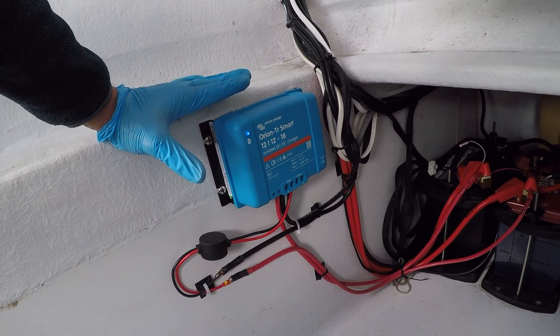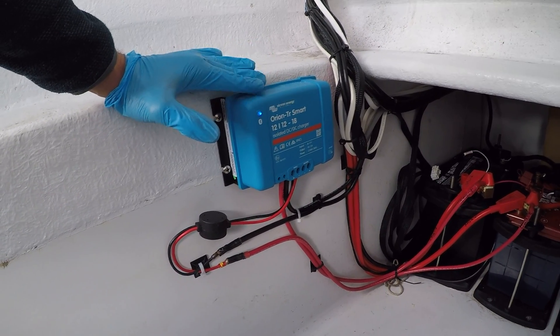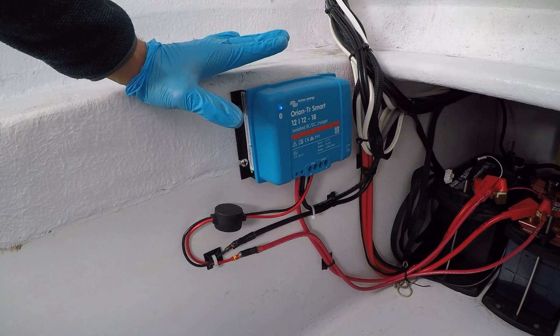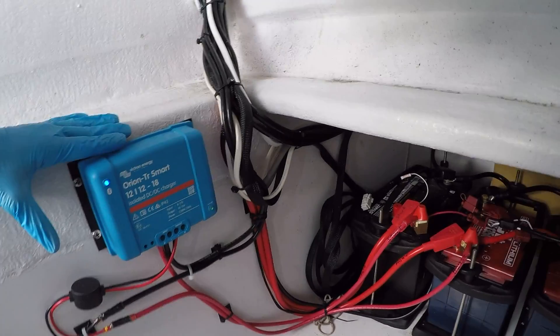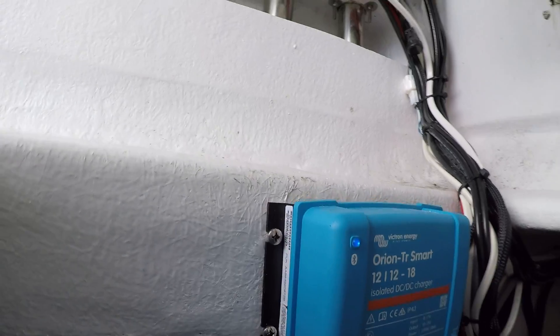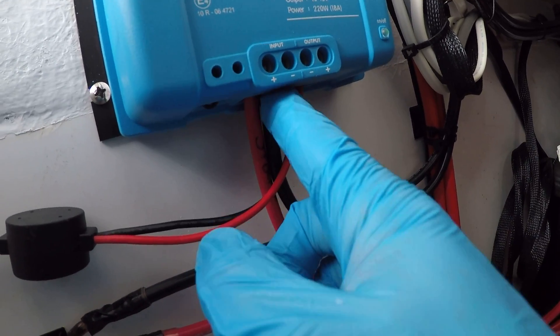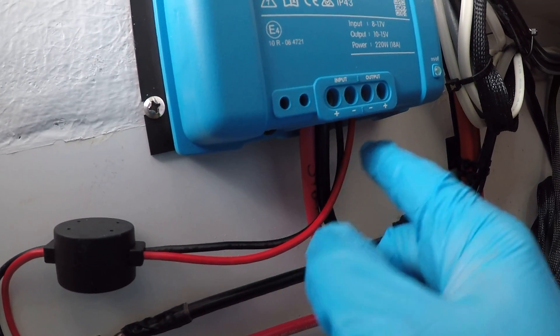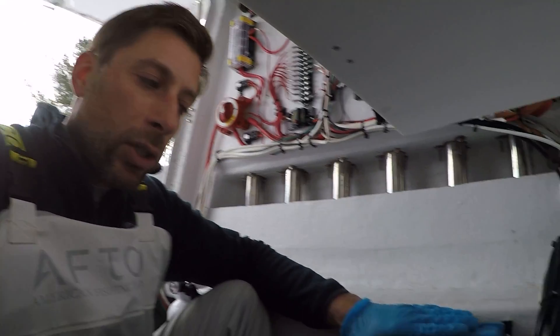All this does is regulate the voltage. This is run by Bluetooth — you control it from your phone via an app. This will ensure that the batteries can only draw 14 volts from your alternator. It was pretty simple to do. All I had to do is run the wires inside the console. You can see right here my input — this is coming in from my starting battery, the positive and negative. And then the output — negative and positive going to the house battery. That's it. The voltage is now totally controlled, so I never have to worry about putting too much draw on my alternator. This is going to protect the alternator. These are relatively inexpensive — I think this was under $200. Very easy to install.